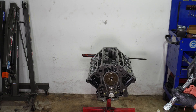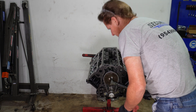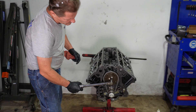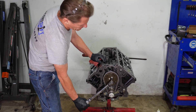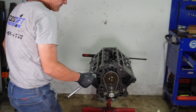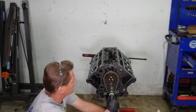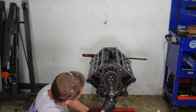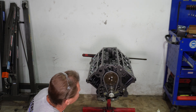These three camshaft bolts get torqued to 18 foot-pounds. Then we'll roll the engine — roll the crank, which is actually two revolutions of the crank — and just make sure that we line back up dot to dot.